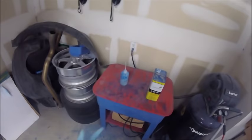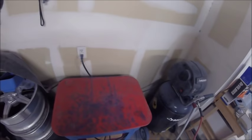And that's just a parts washer I use to clean my gun. Just fill it with thinner and take apart the gun on the side there like I'm showing. And then just have a good fresh bottle of thinners to wash down your gun with. And when it's dirty, you just drain out the old thinner and fill it up with new. Works really great for my purposes.